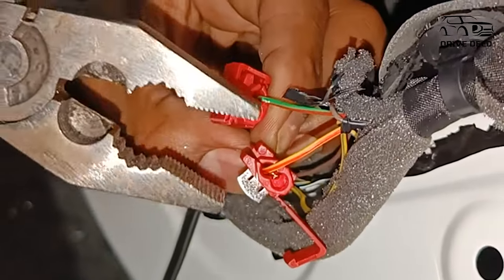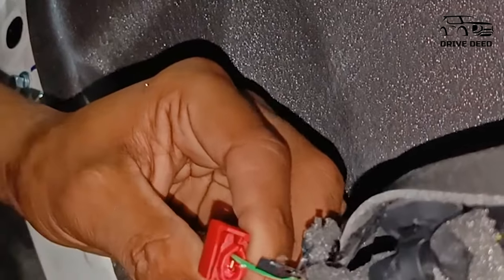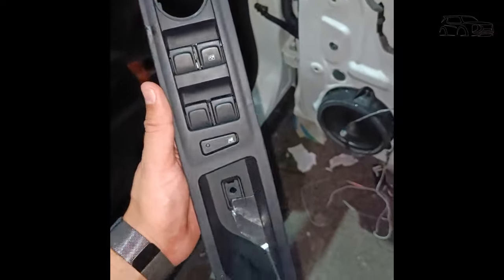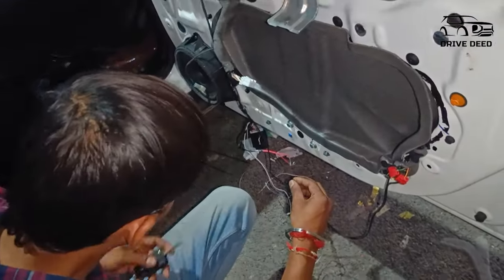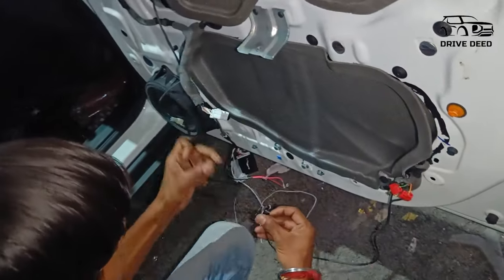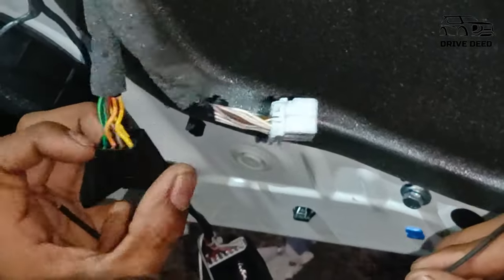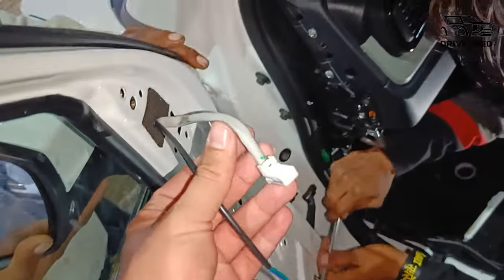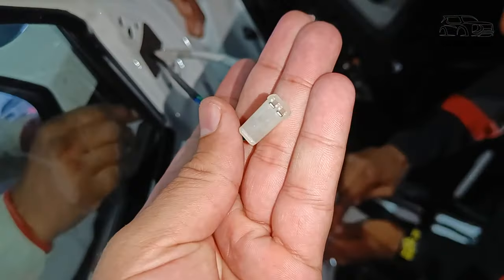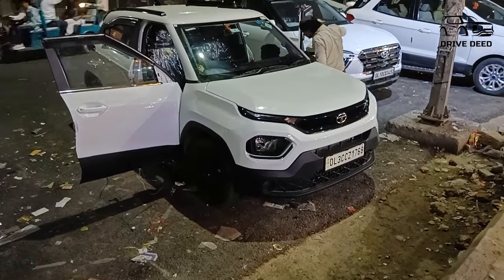In the market, this coupler is used with the wires — it is waterproof and it will remain connected. This is the window switch panel that we will replace, and we will add a new button. We will start a relay which will be operational for key lock and mirror fold/unfold. As you can see, we have two wires: one from the company that controls the ORVM and adjusts, and one wire is for our folding mirrors.